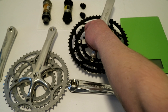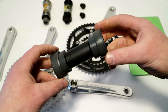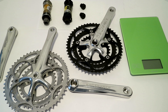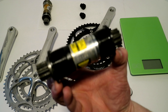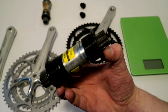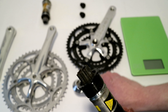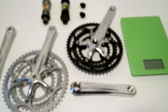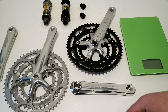What's also pretty interesting is that today's bottom brackets are hollow, often pressed into the frames, with a shaft that goes through rather than a three-piece design. On these older units, you'd have a three-piece design where the bottom bracket would actually thread into the frame, and then your crank arms would slide onto the ends. There were a few different standards — a square taper, which just had a square end with compression, was used on the least expensive bikes. But as you got to nicer bikes like these, you would get different technology.